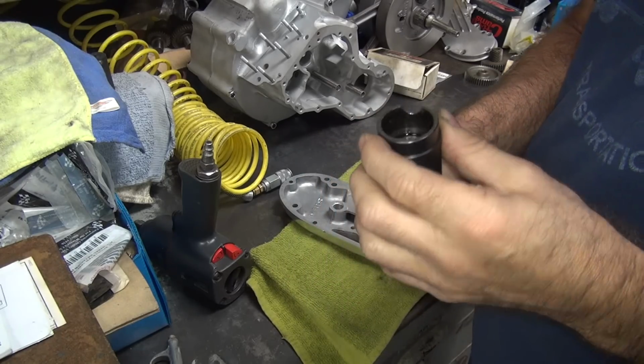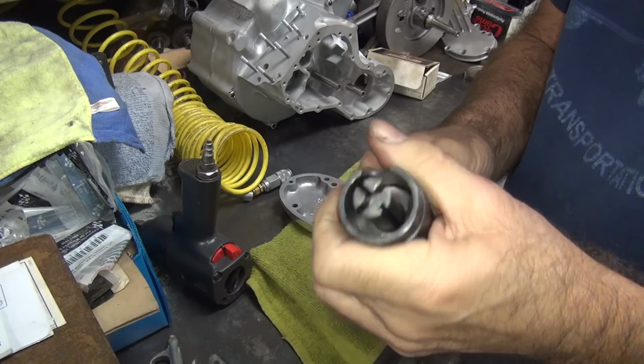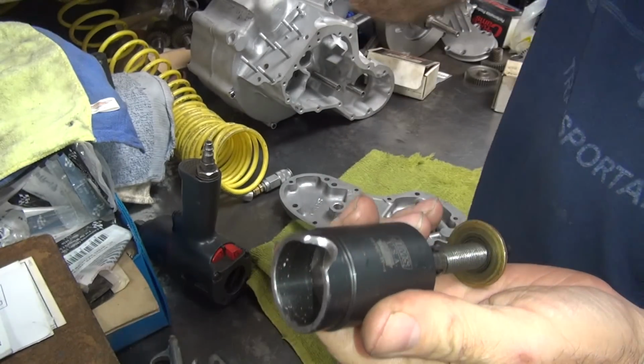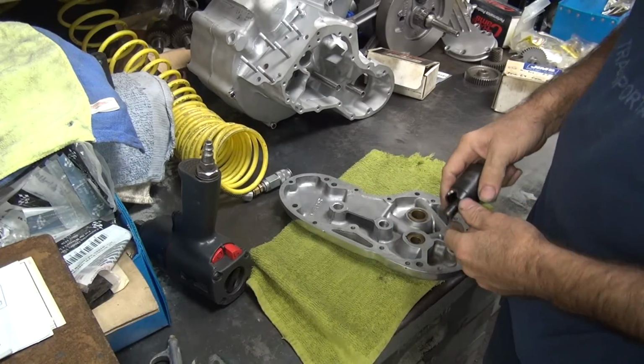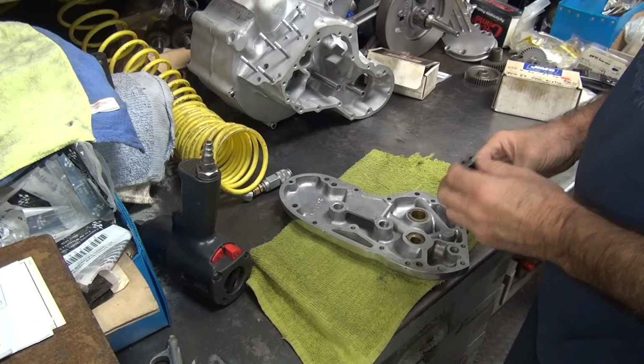No problem. Next thing is I took the bushing, other piece here, whatever you can call it. I had to machine it deeper, and I had to notch it to make room to clear other applications, because this gets used on Sportsters too, even though you're not supposed to.